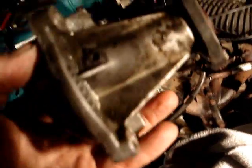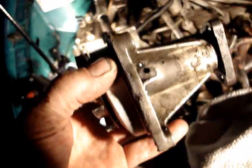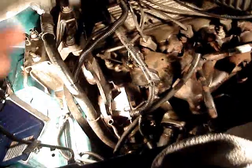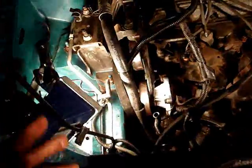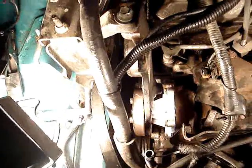Now, just water, I was amazed that that much coolant could leak out through that weep hole. I was pouring it in the reserve tank, or what do you call it, the tank, because they don't put a damn radiator cap on your radiators anymore. And what amazed me is when I poured it in, it ran down through the radiator hose and would run out of that weep hole at the water pump like 15 seconds after I poured some coolant in there.